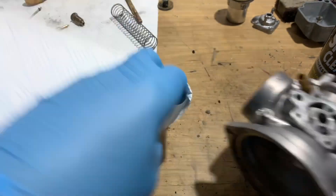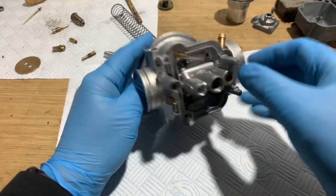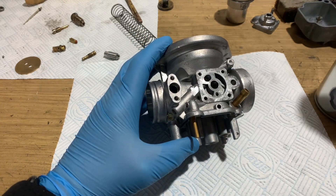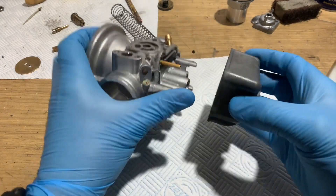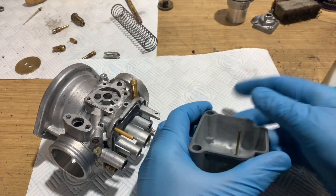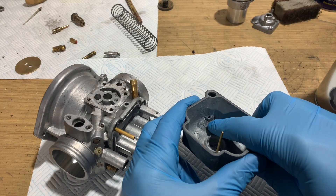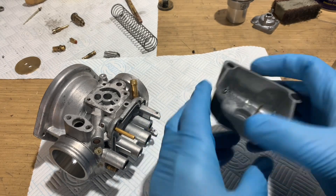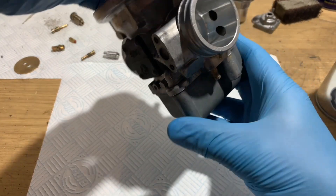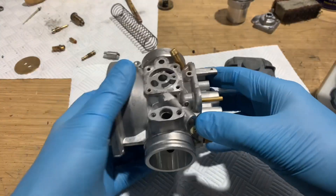Let's put some paper down actually — it's quite cool to see where the stuff comes out. So that is the fuel supply for the choke. When that sits on there, there's a little hole even there, which means that this little chamber fills up with fuel, and then that can suck petrol out into the choke assembly. So that's what that one does.